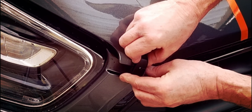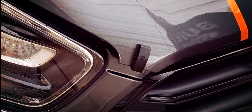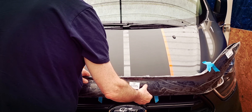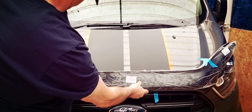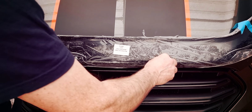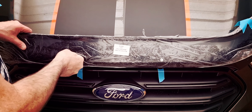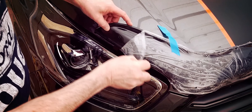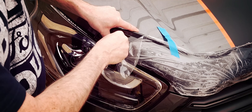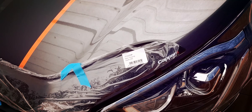All these do is clip straight over the plastic film — push on and just push them until they go click. Same again, just hook it in, push it up, click — and do that with all of them. Now get your deflector and place it on. All you need to do is line up all your screws. You can move your plastic brackets slightly, and just install your first two screws in the middle. Once done, do the same on the ends — don't tighten them fully at this point because you may need a little bit of play to fit your little plastic mushrooms.